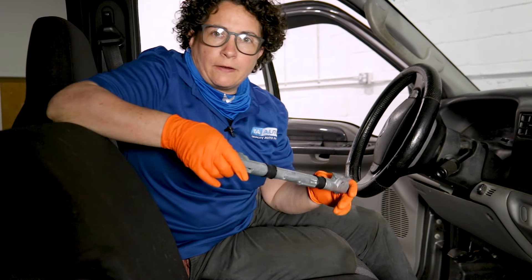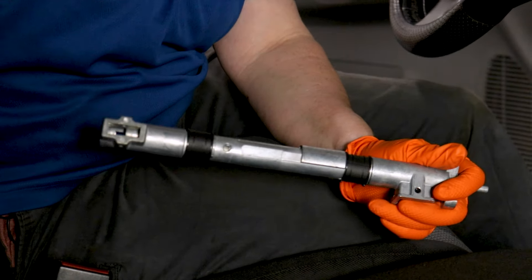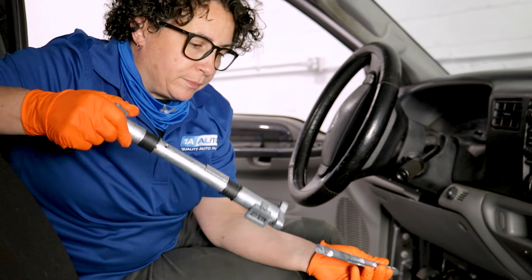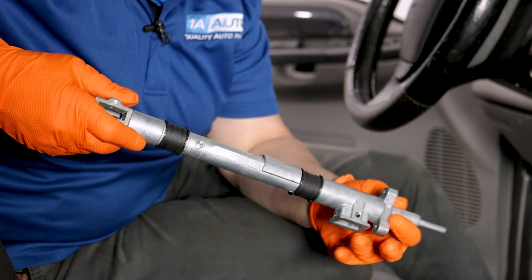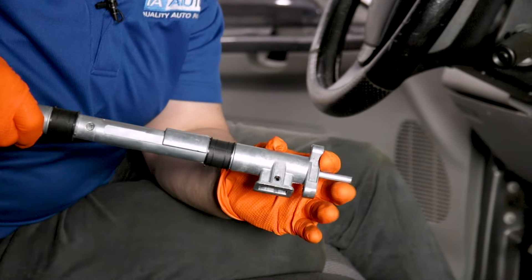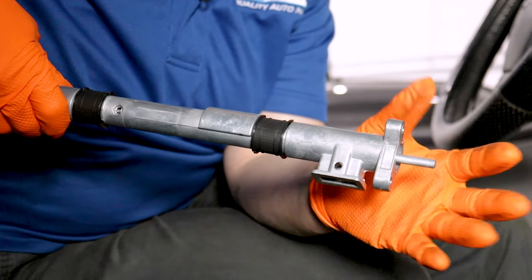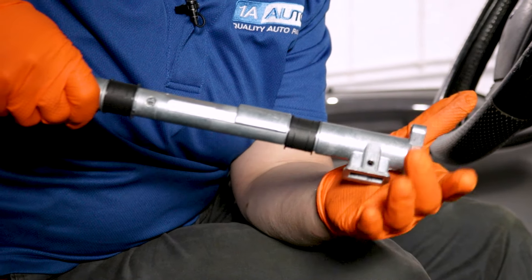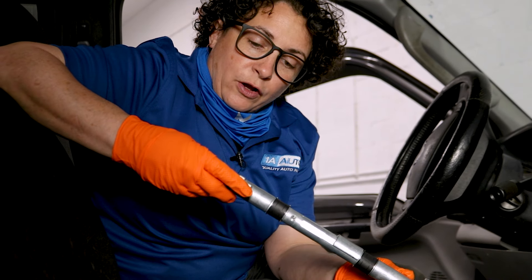This is what we call a Ford shifter tube. It sits inside the steering column on the inside. Right here, this notch is where this lever sits, and inside there is what they call the plunger. That lines up with that on the inside. Spring-loaded on the bottom here, and when we do the job you'll see there's a spring that goes right here, the steel plate mounts here, and that has the actual indicator cable on it, and also the shifter cable.